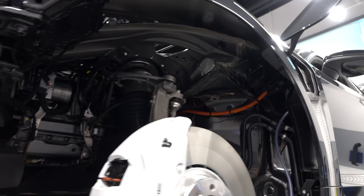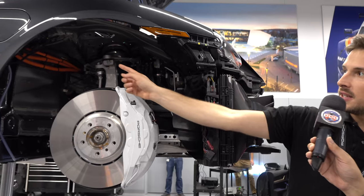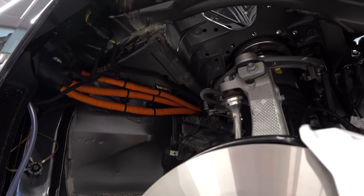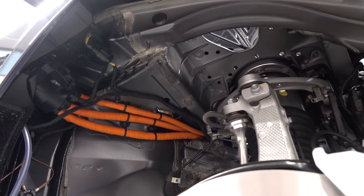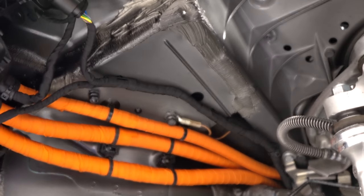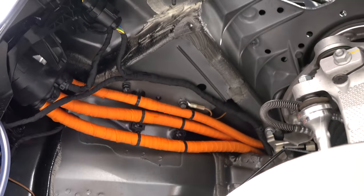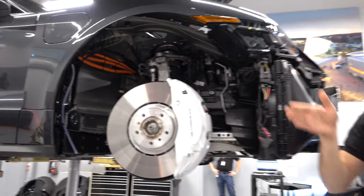On this other side, you can see three cables. On this side, we can charge AC and DC. The small orange cable is AC, and the two big orange cables below are for DC charging. When you pull up to a service area to charge, you have to choose — you can't stick two adapters in to charge on both sides. One charging plug will be blocked once the other one is open, for safety precautions. On highway charging, this would be DC — high-power charging up to 270 kilowatts, making very fast charging speeds. At home in the US, you'd probably charge with 9.6 kilowatts AC.